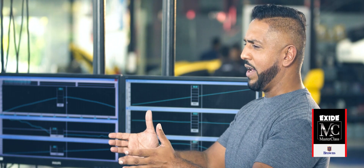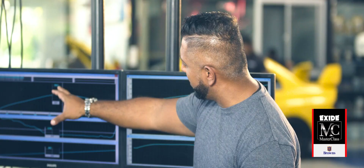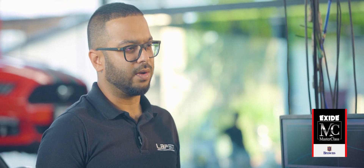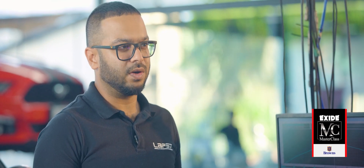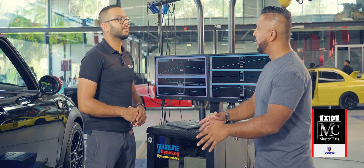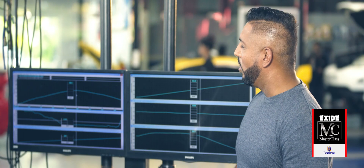When this car comes out from the factory, Mini will tell you it's got about 240 to 280 horsepower. So how do we relate this number to that number? When we talk about wheel horsepower, it means the horsepower that's actually being put onto the road after drivetrain losses and wheel losses. Basically this is what you're going to get on the road. What the manufacturers tell you — 240 horsepower — that is not the wheel horsepower. That is an engine horsepower rating.